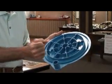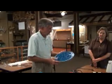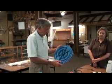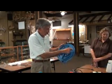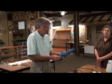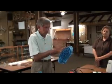It's much more difficult for the motor to pull that dome back and forth, and the eggs probably won't turn properly, and you probably have a high chance of burning out the motor and the egg turning box. So once again, check and be sure there's a little Teflon strip at least 4 places in that groove. If there's not, you can call us. We have a supply of them, and we'll send them to you just like a piece of tape. You cut it off, stick it in there.